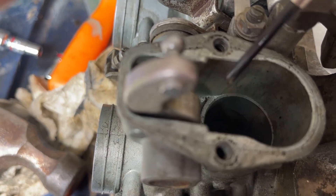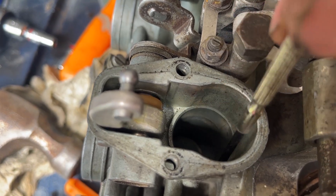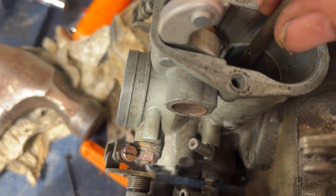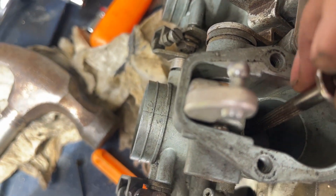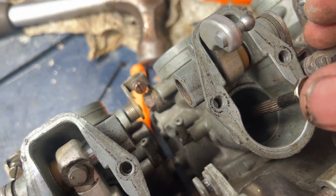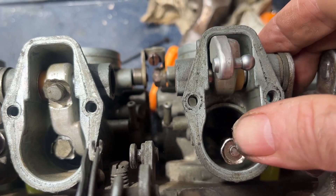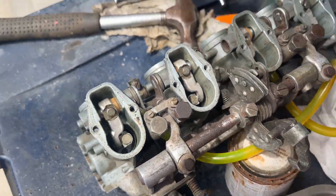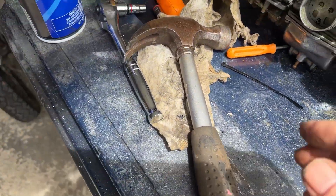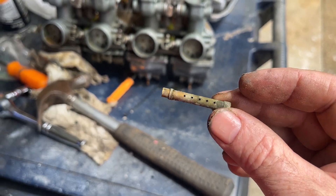The screw has a piece and then there's one under it too, so be careful about that. I have a screwdriver here that is a little smaller than the hole going into the emulsifier tube — because the inside actually gets thinner. If you find something that will push just inside that hole, I already tapped it so I know it's going to come out. This one I think was fine because I can see through it; the other one was completely blocked.